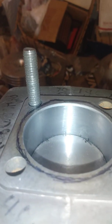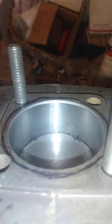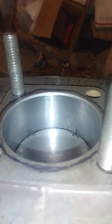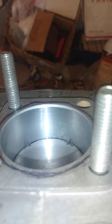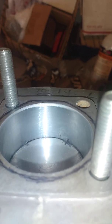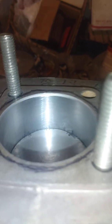A couple people sell motors that run a different port shape, and the question is why do I have a mushroom-looking port shape? Number one, having an even port opening has a lot to do with power delivery. Number two, we're working with what we've got — these aren't Yamahas or Kawasakis, so we're stuck with the parameters, i.e. the port shape we're given, and we make the best of it. The spark's gone, bang, piston's traveling down, hot spent gases and pressure built up — you want your port opening to open nice and even.